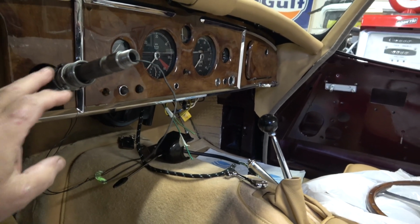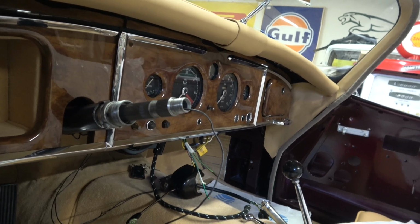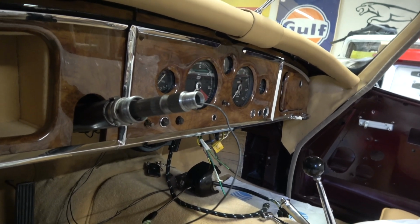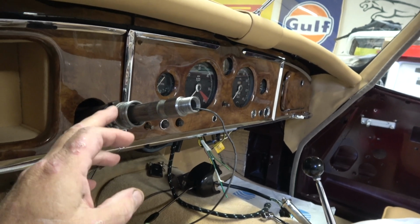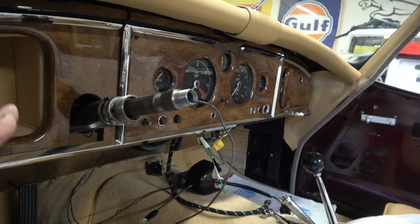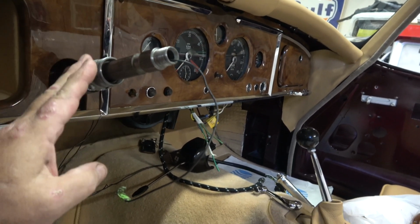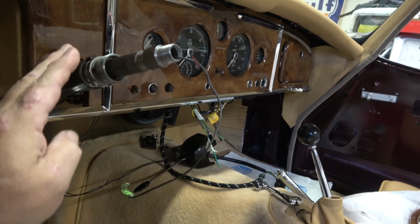So what's actually happening is on the original you can turn it just over 7 times, 7 full rotations, whereas with this it's 2.5 rotations, so it's not even halfway. But what he's thinking about is we could use one of these square thread pitch files, you know, where it's a square and you can basically chamfer it, and if you put the engineer's blue on it, we'll see where it needs to be cleaned up.